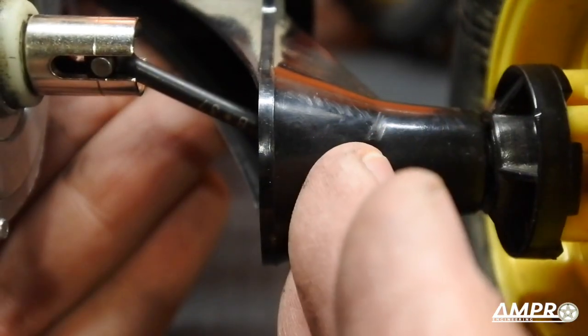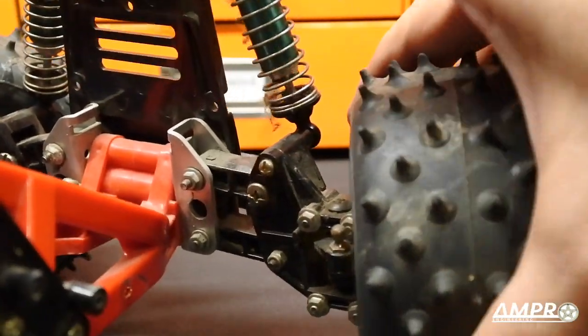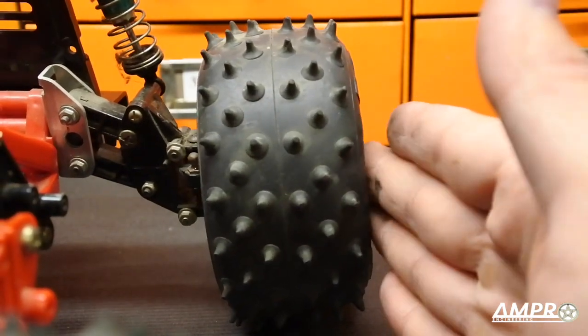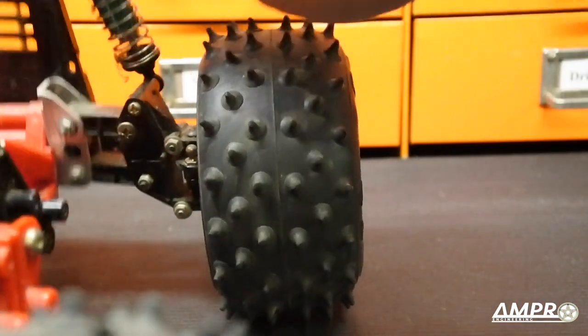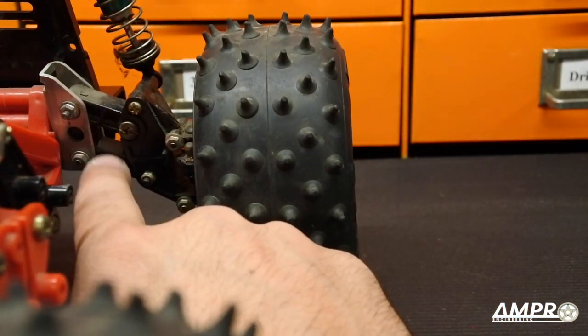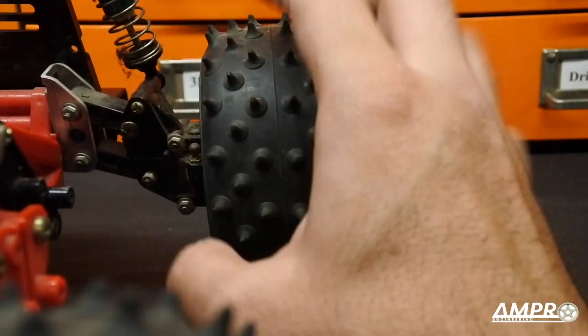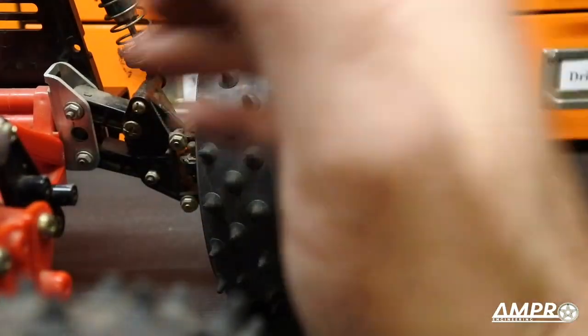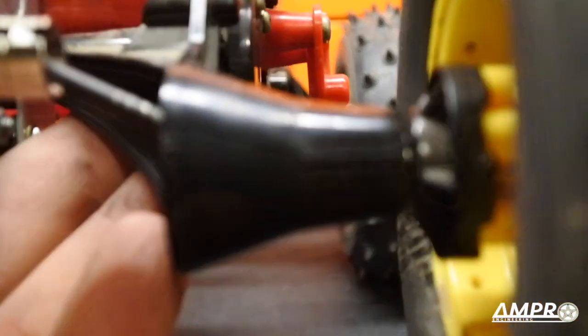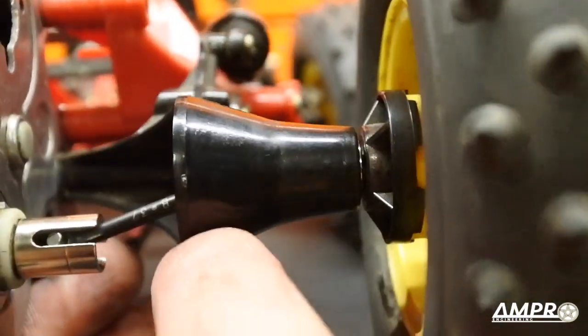The reason for that is because this axle's center does not move like it normally would on the front suspension. The front suspension is a double wishbone style — and on this car, if you measured the tire's relaxed position versus its fully compressed position it would actually be sticking out further, because as these upper and lower links become horizontal thanks to trigonometry they also get longer with respect to the center of the chassis. In this case that doesn't happen — these are fixed at the pivot and it just goes up and down with no camber gain, it just stays constant.